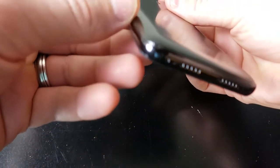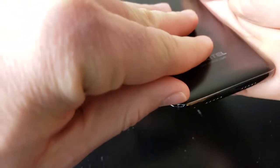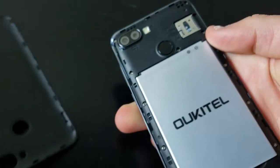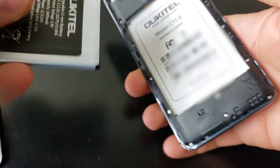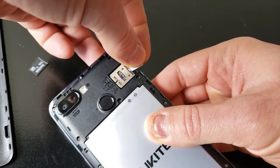There's also a dual SIM and SD card slot, and it's hiding under the removable back cover. The process for installing the SIM card is a little ambiguous, so let me quickly show you. First, pry the back cover using the little groove on the bottom left — and when I say pry, I mean pry; it feels like the cover will snap, but don't worry, it doesn't. Once open, you'll see the battery and SIM card slots, including that 3400 milliamp-hour replaceable battery. Be sure to remove the sticker covering the battery terminals or the phone will not power on.